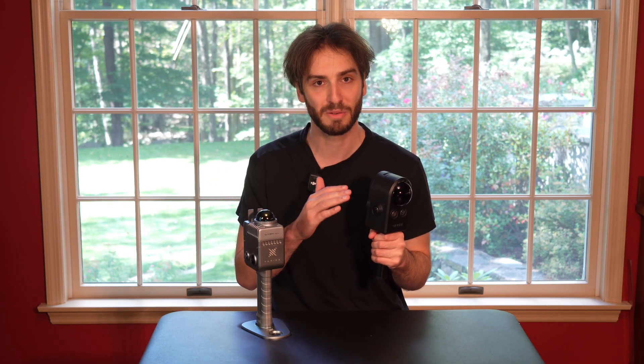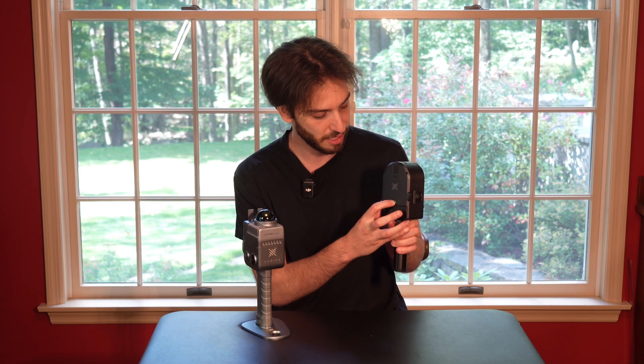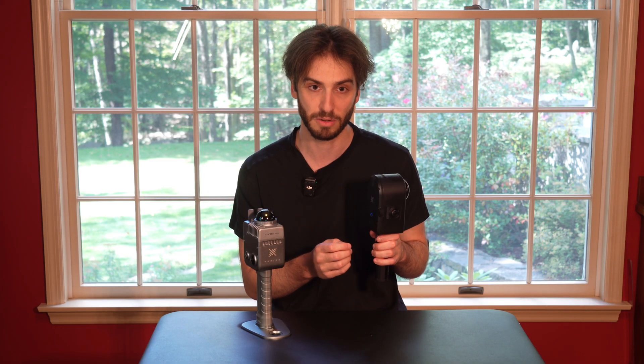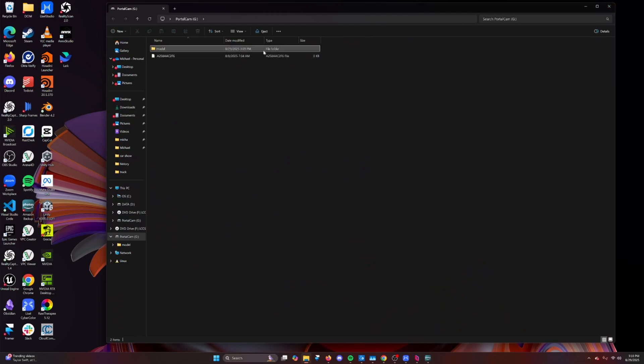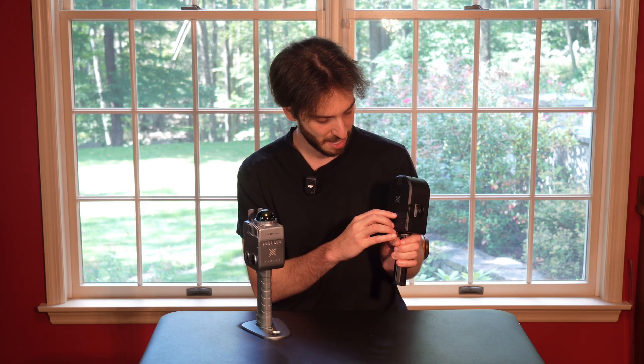Once you've captured everything, you need to transfer it from the PortalCam to the computer. Connecting via USB mode is significantly easier compared to the K1. You double-tap the activity button twice, leaving a second in between to let it turn white first, then tap again — once it turns blue, it's ready in USB mode. There's a USB-C port on the camera; just plug in the cable and drag and drop the files to a new folder. Note that you can't charge the PortalCam while using it in USB mode. To exit, double-tap again until it turns green.